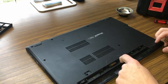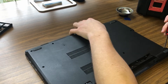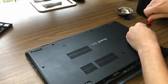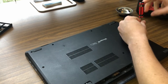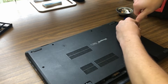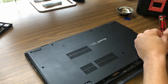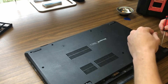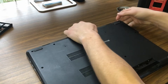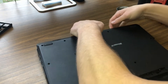That all looks good. The CD drive area is always tricky — most of the time they actually do put screws in there, normally about three or four small flat Phillips screws. You don't want to forget about them because if you do you'll damage the CD drive where it goes in and out, and you might have an unhappy customer. I've never broken one personally, but I could see how it could be very easy for a new person to do. This is all looking pretty good so far.